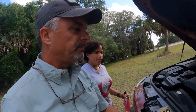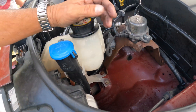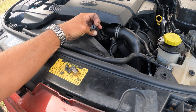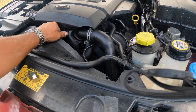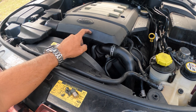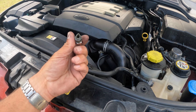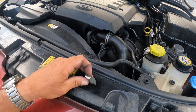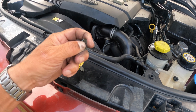It turns out to be antifreeze or cooling fluid. If you look at it here, it actually broke and ran out. I stopped it in time so it's not that hot. I just realized it's actually the hose up here connected in behind somewhere. With it, the vent came out as well and it's completely deteriorated — it's actually so bad that you can take it apart with your fingers. It's completely dry rotted.